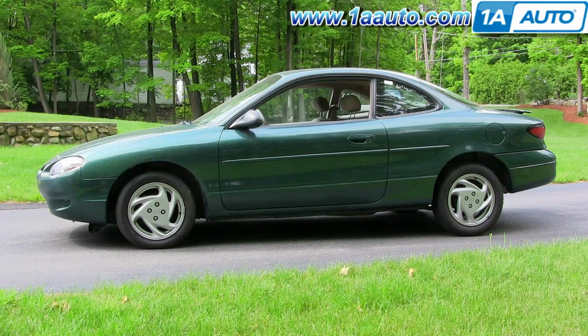Thanks. In this video, we're going to show you how to replace an ignition coil on this Ford ZX2. This has a 4-cylinder motor. This procedure is the same for a lot of Fords with this 4-cylinder 2-liter dual overhead cam engine. And the only tools you'll need are a 7mm socket with a ratchet and an extension. And you'll also need a small flat blade screwdriver.